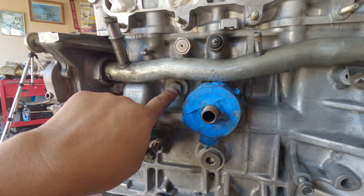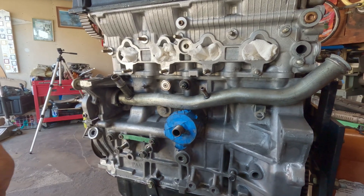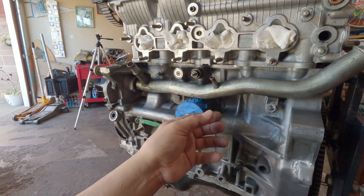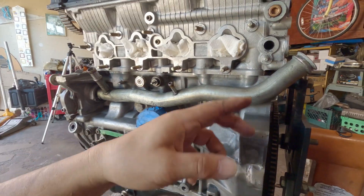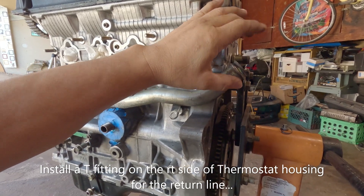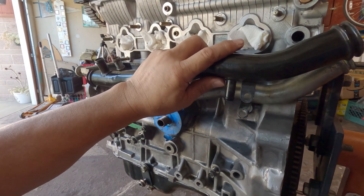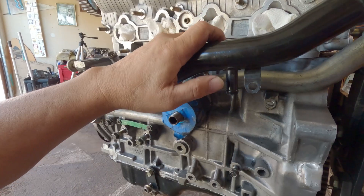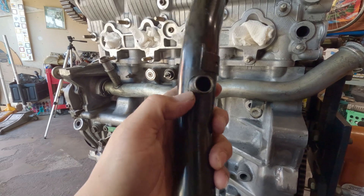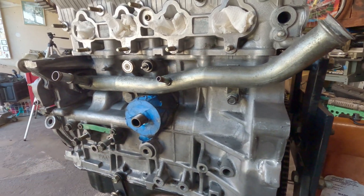Then tie it up to that one right there, open it up, thread the pipes right here, and connect it through there. If you are building a boosted motor and thinking of using water cooling lines for your turbo, keep this one as a return. Just think of a place where you can tie it in — either on your thermostat housing, put a T-fitting on there or something. For this port you can connect a hose and plug the other end, or if you have welding equipment just weld it shut completely. Since I'm not running a turbo here, this is an NA setup.